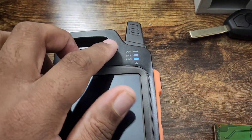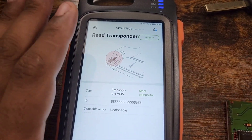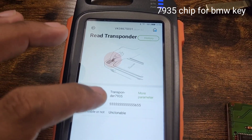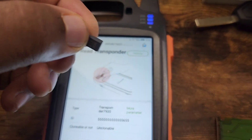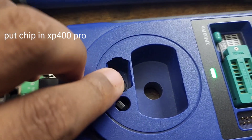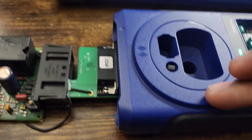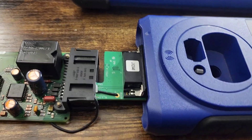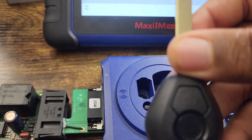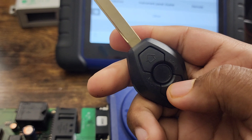I have the T2 Max here and a chip — this will be the chip going into a BMW key. This is a PCF7935 transponder, it's an ID44 chip, that I'll be using. This device is just being used to show you the transponder. Once the data is programmed to the new chip, you just take it, put it in the BMW key, turn the ignition, and the car will start. The buttons you program in manually.